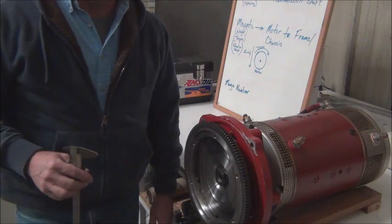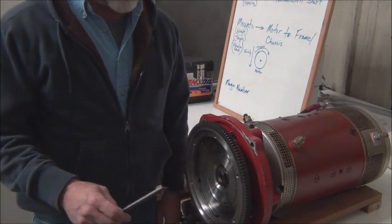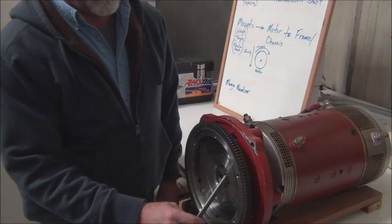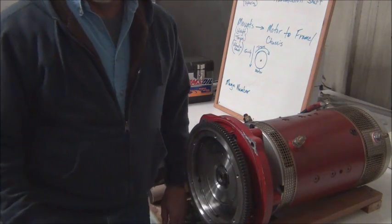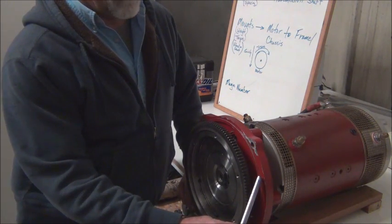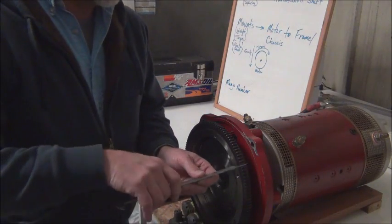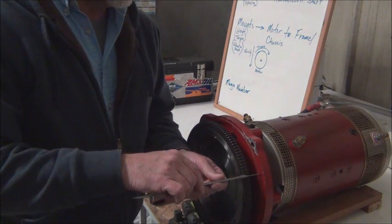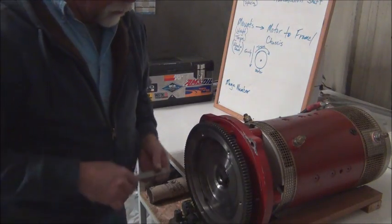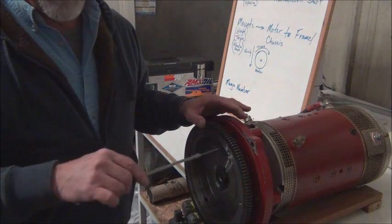When you remove the internal combustion engine from the vehicle, that dimension we were talking about — that magic number — is from this mating face here to this face here. This is the face that mates to the clutch. So the distance between here, the mating surface to the bell housing, to there. You take a caliper and simply take a reading. We usually rotate the flywheel, take multiple readings that way, take multiple readings around, and make sure we have a number that is accurate — not just based on one reading in one spot.